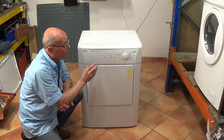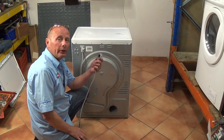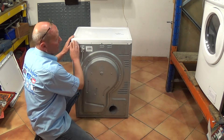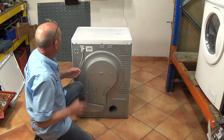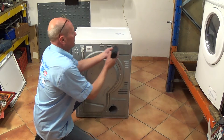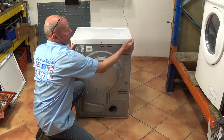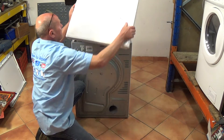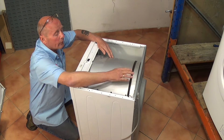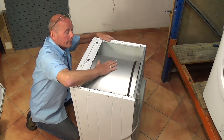This humming noise is coming from the motor — this is a good sign that the capacitor has gone. The first thing you need to do before touching the machine is unplug it from the electricity supply. There are three screws on the lid which hold it in place. Just ease these screws out, the lid will then come up — give it a jiggle and it will come off.